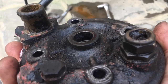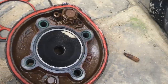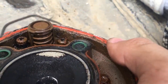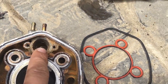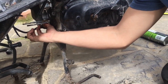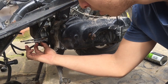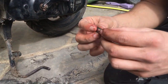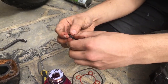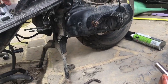Before putting the 50cc kit back on, take off the thermostat from the current kit — mine's here, I've just got one screw out and I'm having trouble with the second — then put it straight back into the new one. Get the small-end bearing out of your crank, make sure it's all good, and absolutely soak it in two-stroke oil or assembly lube. Your gudgeon pin also — absolutely soak that in two-stroke oil as well. Put a circlip in the side you prefer before the piston goes back on.